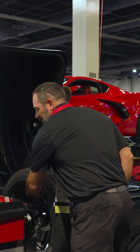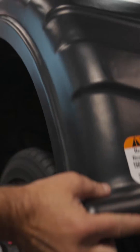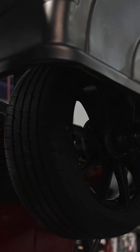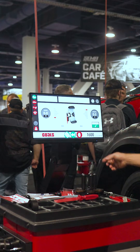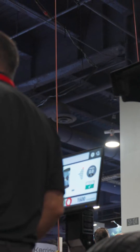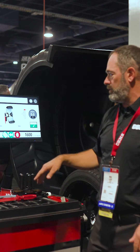I'm going to place it at top dead center, right in the middle of the barrel of this rim. I'm going to do my check spin one more time. Once this is approved and everything's good, you'll get a green check mark — this will definitely let you know that you have actually made really good balance both inboard and outboard dynamically and statically, so there is no leftover residual.